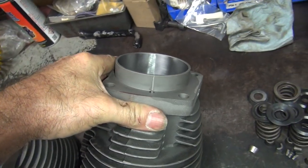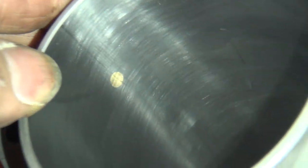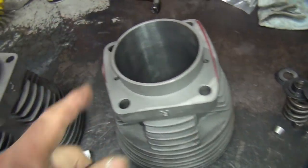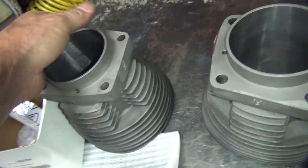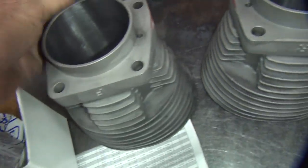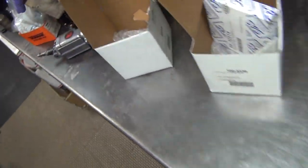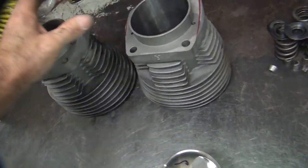I used a nice good cylinder finish in there. You can see where the brass part is in there — where we welded up the drain holes. They're no longer in there. We drill them on the outside. You can watch the previous videos to see what that all means — the drain on the outside of the case. You can see how this one gets pretty thin. This one's thin here a little bit, and this one's the worst, which is our front hole. I've got these honed already.